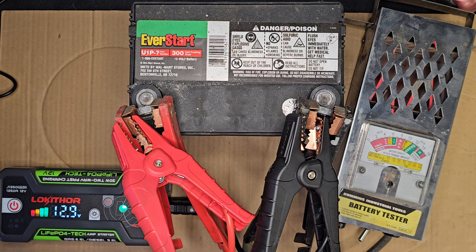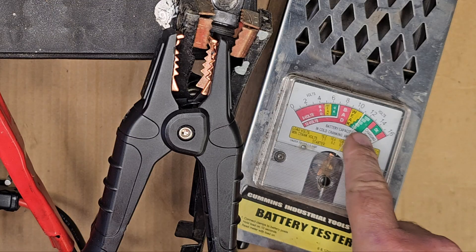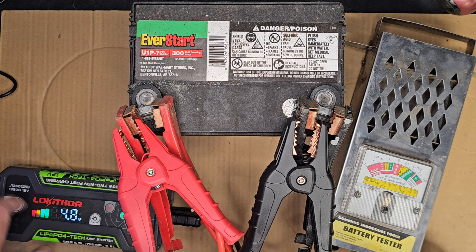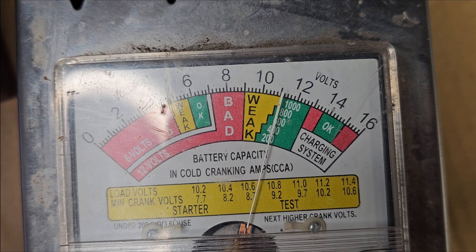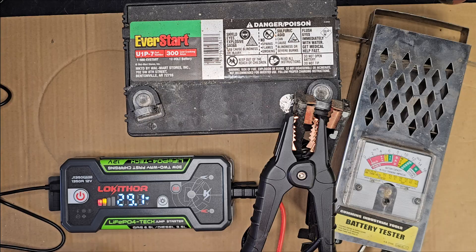We'll shut it back off. If you have to give it a heavy duty boost and your battery's completely shot, that's how you do the manual bypass mode — which sets these apart from a lot of other jump packs that cannot do that. That's hot now. The battery itself looks like almost 11 volts but when it gives a little test load it shows 4.8 volts, so I think this battery is probably shot — you can see it keeps dropping pretty fast under load.